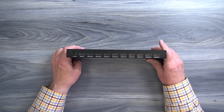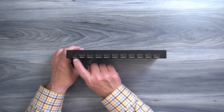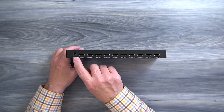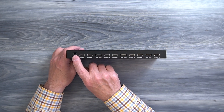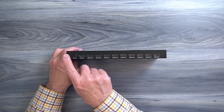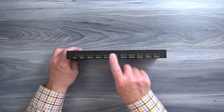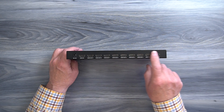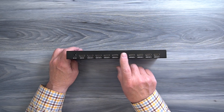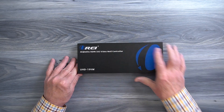On the rear of the unit is where you'll make all your connections. Starting on the left you'll find a DC input port used with the included power supply — plug that into a standard wall outlet, and the barrel connector on the other end plugs in right there. To the right of that is an HDMI port labeled HDMI In, which connects to the media device you'd like to display across your video wall. Then to the right of that are nine more HDMI ports that connect to your monitors to create that gigantic video wall. It's really important to use a high-quality cable for these connections to ensure the best quality picture.